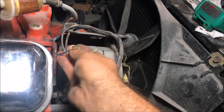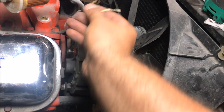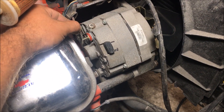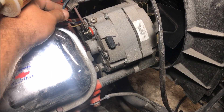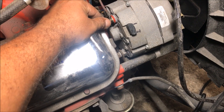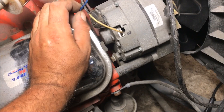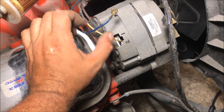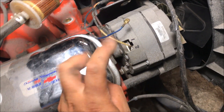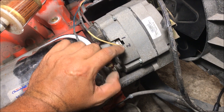You can't leave these wires out — this is connected straight to your battery and it's going to arc out and cause all kinds of problems. So for a one-wire hookup, all you're doing is taking your existing wire off your alternator, cutting and capping or plugging these two wires, and just screwing that back down. Number one is the exciter wire — it comes on with accessories from your key switch and excites the alternator so it instantly charges and does not have to kick in with that chirp. The voltage sensing on number two just goes back to 12 volts — this is the one where you can loop it right there if you have to.